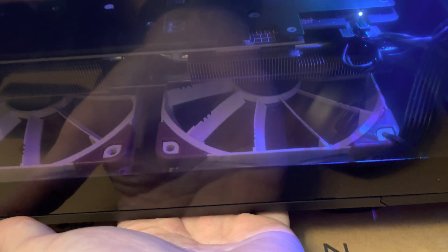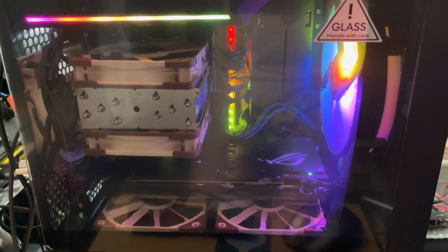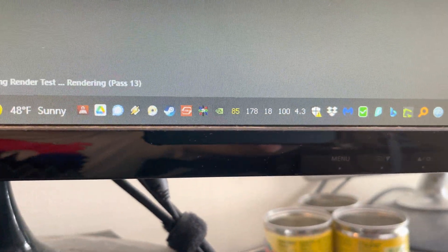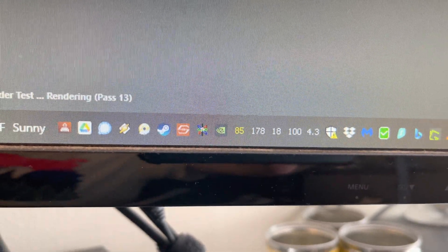This case needs more air coming out. It's got a big intake fan on the side and two Noctuas on the bottom, so there's positive pressure in the case right now. The CPU temperature is at 85 Celsius — yeah, it's a hot chip.